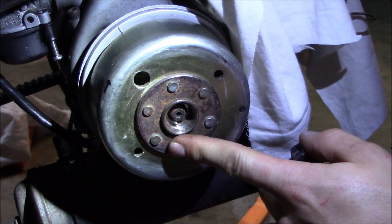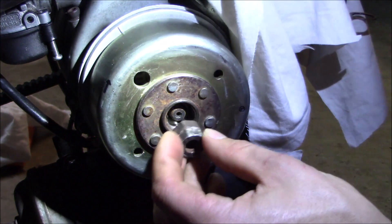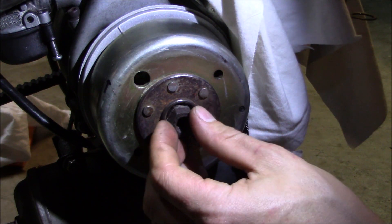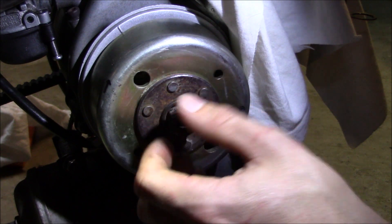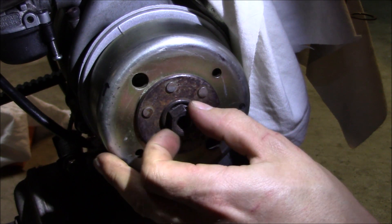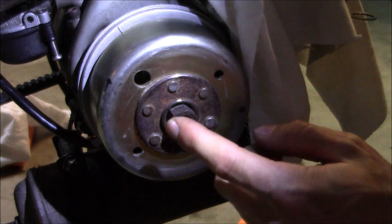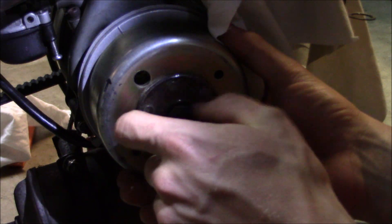These CDI kits are sweet but they have one unfortunate flaw — the flywheel nut. There aren't enough threads exposed on the snout of the crankshaft. If I'm being generous this gets like two and a half threads, which is not very good and in my opinion is asking to have it stripped out.